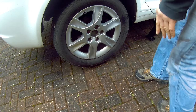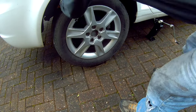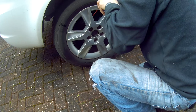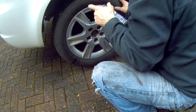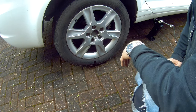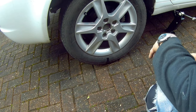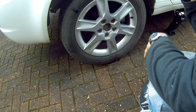The wheel's stuck on — corroded round the centre cap. Put some WD-40 around there and let that soak a bit. This just shows you that if you don't put any copper grease round the centre cap, this is what you get: a wheel that won't come off. Hopefully that will just penetrate enough so I can knock it off.